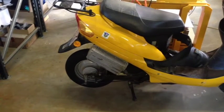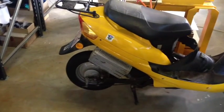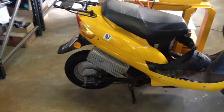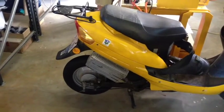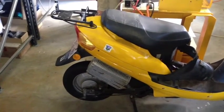So that's on full throttle? Yep, that's the maximum speed that the motor would naturally do at 48 volt. That's about 700 RPM, which equates to about 60 to 65 kilometres an hour.